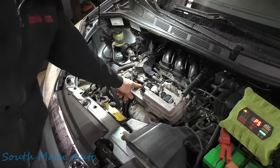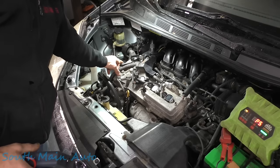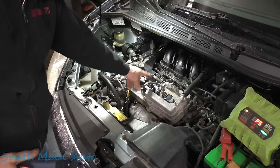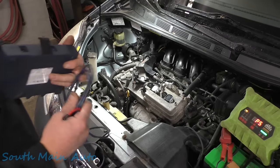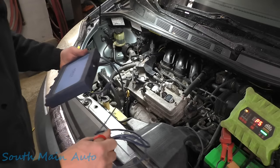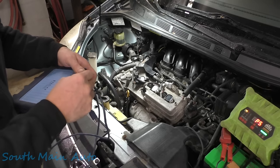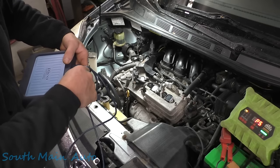Looking at service data - I didn't see these right off - these are the exhaust cam sensors here in the middle of the valve cover. You've got exhaust cam and intake cam sensor on each bank. The other one's under the intake in the back. Fortunately for us, it is the intake cam that's having a problem with - it says bank one, and by a little bit of research it should be this one back here in the corner. It basically states that any fault essentially with the cam sensor and or the cam timing - so if the timing is off, evidently it will also set the same code.